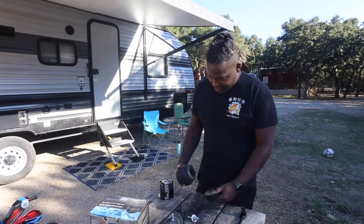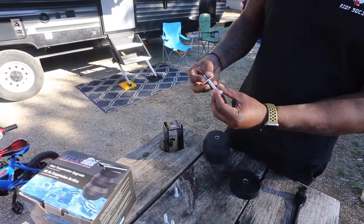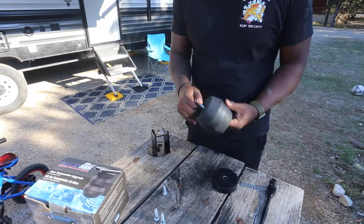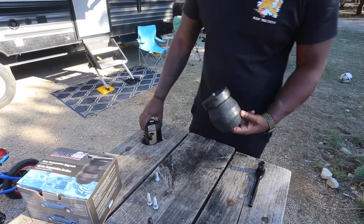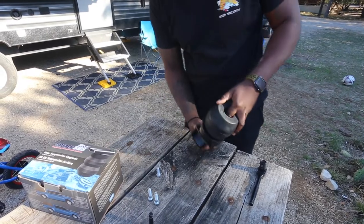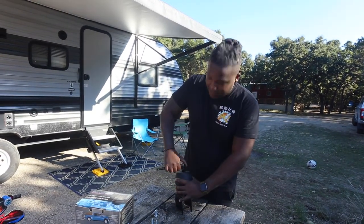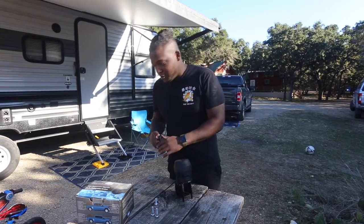You're basically just going to pre-fab these pieces. You have this long bolt with a flat washer and a spring washer — you're going to install them like this: flat washer, spring washer, bolt. You're going to come through the bottom of the Timbren, then put this top on. It doesn't matter which way — they're not labeled, it doesn't matter. You're going to put it on the bottom side of the bracket that's going to mount to your frame. I'm going to get it good and tight on the table, but I'm going to torque it to the proper spec when I get it under the truck. Always use your specs from your instructions.